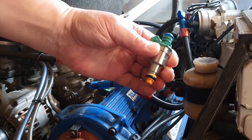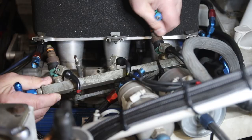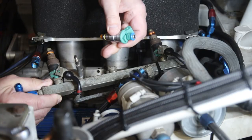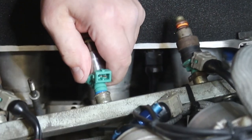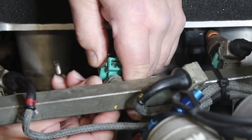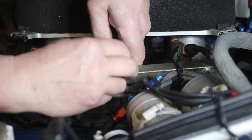I then spent a few days putting in the new injector, which is tricky in a slightly confined environment in the back of the car. That is the injector rail — as you can see there are two fitted, slightly grubby looking things, but I'll leave them alone. That's an O-ring seal at the top — it looks like a new Greta Thunberg proof one, because the old nitrile elastomers get dissolved by modern fuels. That just pushes into the rail. There's a groove in the injector that it clips into — got it on the second attempt. Standard Bosch plug.